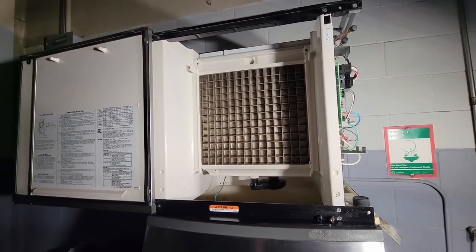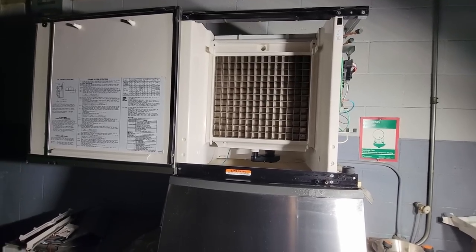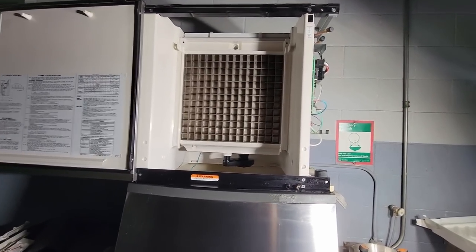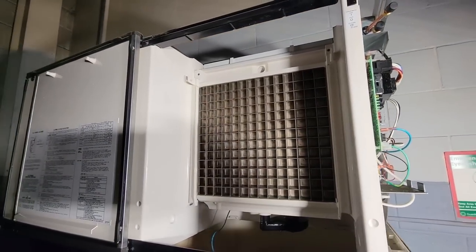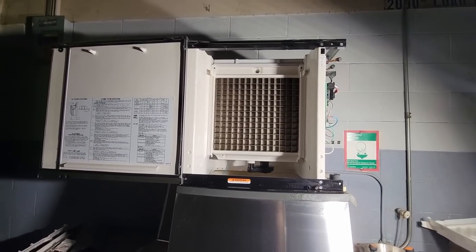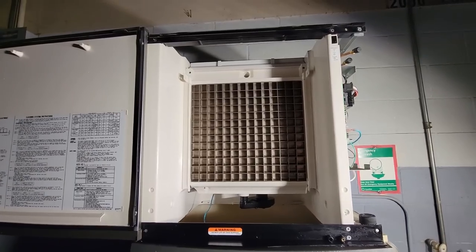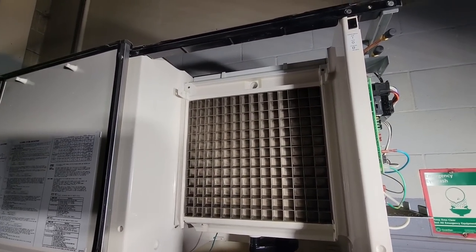Let's see if we can make ice now. Honestly, it comes down to filthiness — generally 90% of ice machine calls out there will be filthiness. Very few are actually going to be a control board failure. Most of the time they're water related more than refrigerant related. We had a switch that wasn't working, we had an evaporator plate, we had a water distribution tube that was completely nasty — we've got all that cleaned up. We've got the plate descaled.